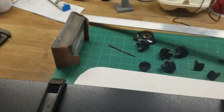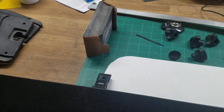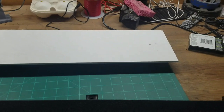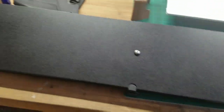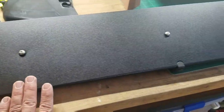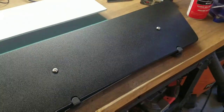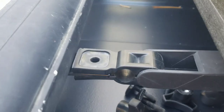So, again, very simple. It's 48 inches wide because that's the length of this board. These boards come in 48 inches by 24 inches. So cut one in half, actually a little bit less. I think this is about 7 inches. Folded it over, put a little angle on it. It cuts very easily with a razor. Rounded the edges over, sanded it slightly round, drilled four holes, and used some stainless hardware to put it all together. So let's go to the Jeep and put it on.